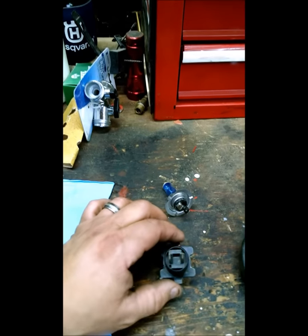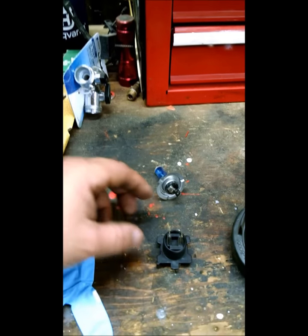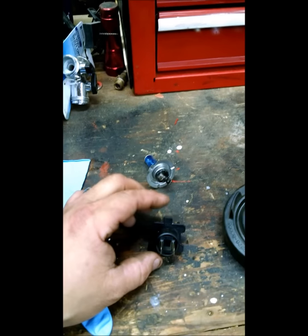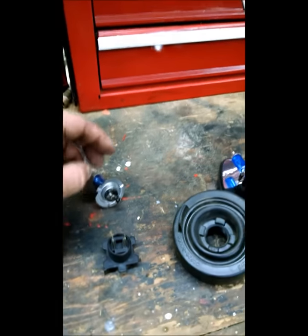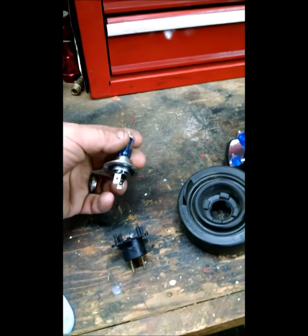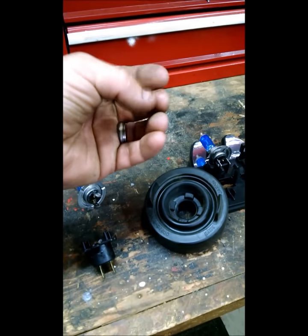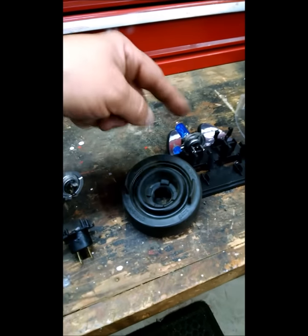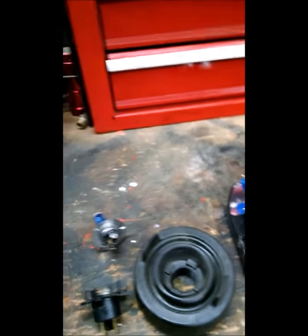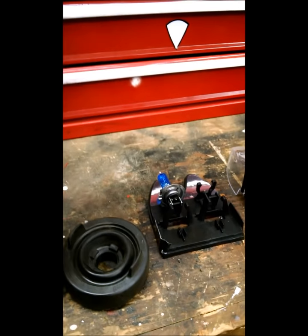It's a really stupid design if you don't know how to access it — the first time I did it I broke it off. I tried using crazy glue and ended up gluing the plastic to my fingers, which was a big fiasco. Now, this is the old light bulb which is why I'm touching it. Your new light bulb you don't want to touch — the oils and dirt on your fingers will blow it out prematurely pretty quickly. So you want to use a glove when handling it.